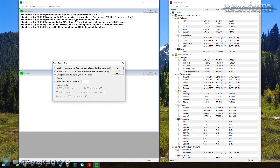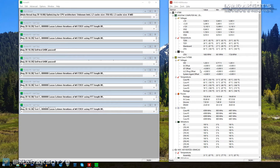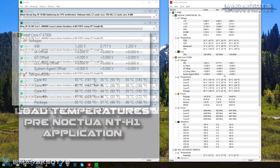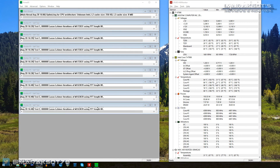So now let's start up Prime95 and see what happens. I'm going to let it run for about 15 minutes and then show you guys where we're at. It is now the moment of truth to see if that Noctua paste has made any difference. Looking at these temperatures and comparing to the screen capture from before, it looks like we are right about the same — right there in the mid-80s, 85, 86, 87 degrees or so. That's about what we had before. So it looks like the exercise of pulling the CPU cooler and applying new thermal paste has not really done anything to improve our thermals. But now I know for sure that even though I had a little too much thermal paste on there, everything was pretty much as it should be.